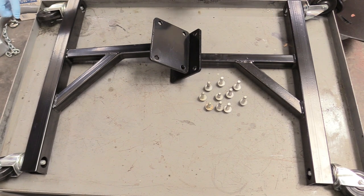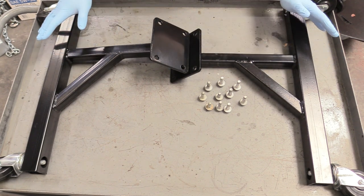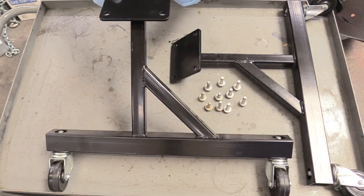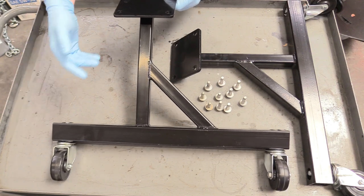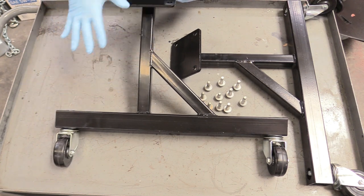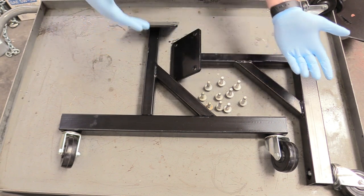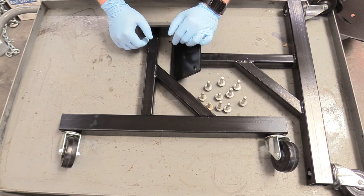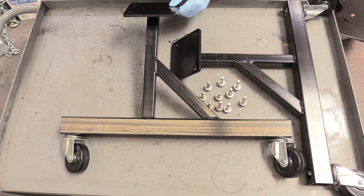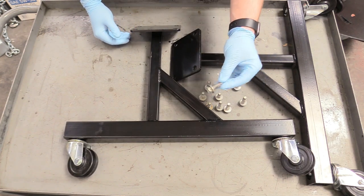This next step is vital if you are going to be putting this engine on a dyno. If it's going directly in a vehicle, you can skip this step. What we have here are some Summit Racing branded engine feet with wheels on them, which is really nice. You want to use these whenever dynoing so you can move the engine easily. I really don't like just using an engine stand because it has a higher center of gravity — if it's in the back of a truck and you take a turn, it might fall over, which would be tragic. These are cool because the center of gravity is very low. Summit sent these over — link in the description.